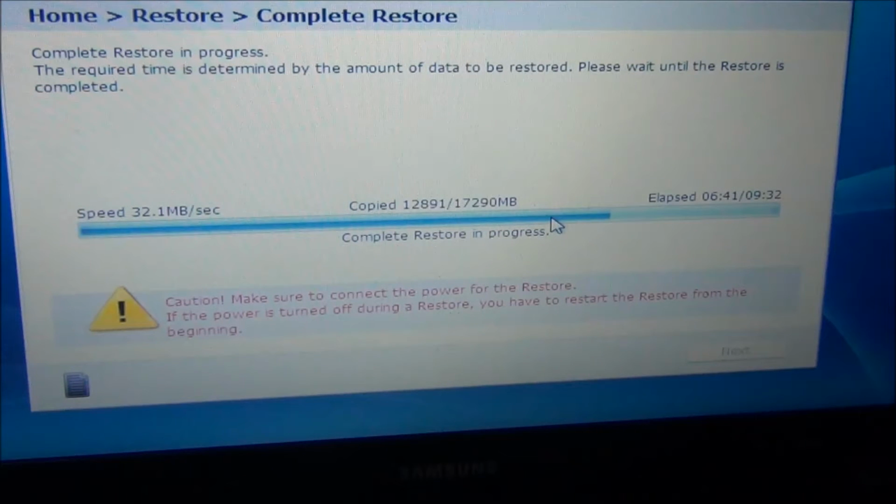moving on. Like I was saying, one reason you can't get it is because it's damaged. Second part, which is more than likely what happened, is that it was reloaded. You might have taken it somewhere to a shop before, or Geek Squad, and they used their own reload disk, and they wiped your original recovery partition, and they just installed theirs using their Windows 7 disk, which is more than likely the case. Or, I don't know, someone else could have restored your computer, or you could have restored the computer before by accident and made a mistake and deleted the recovery drive.